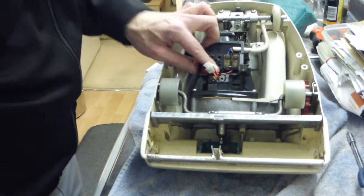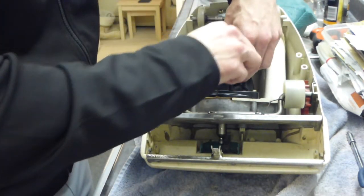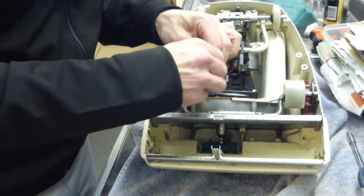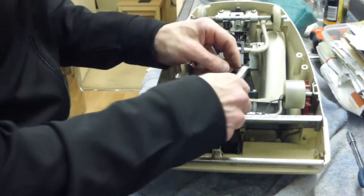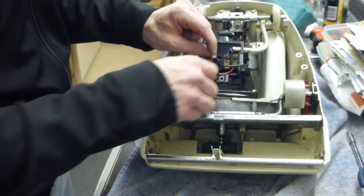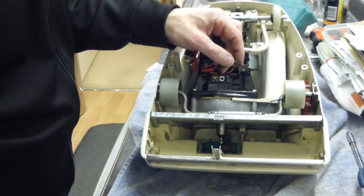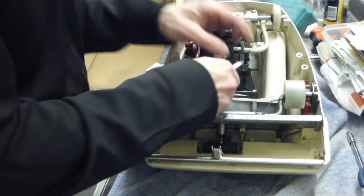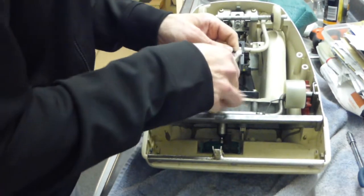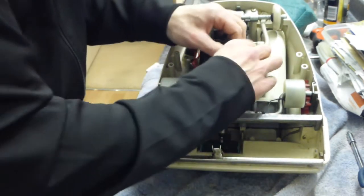And I need to strip that black wire down as well, because that's starting to fray and it's not a very good connection, so I need to re-strip that. Let's chop that off. This is basically the wire that goes from the neutral side of the carbon brush. It's going to go onto the neutral terminal of the cable. Again, it's something I had to do when I removed the suppressor, because otherwise that would have gone to the suppressor, if I remember rightly. And it's a devil to try and strip these wires as well. That's it, we got it.